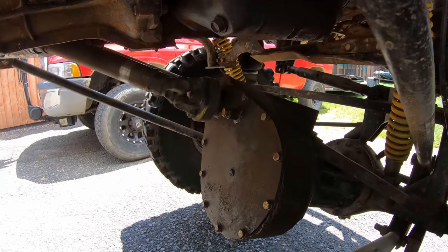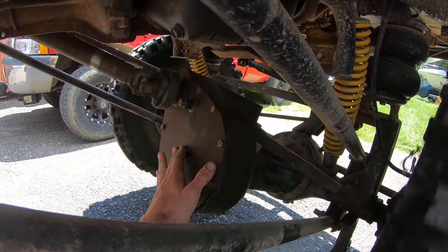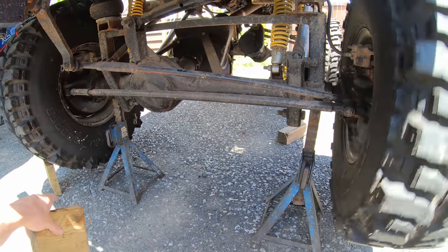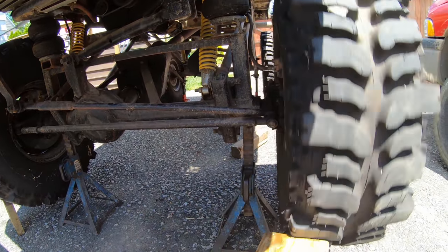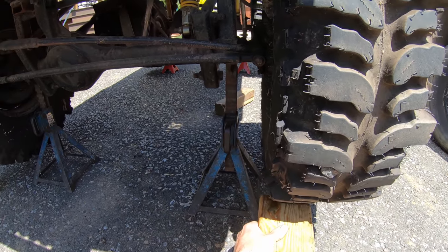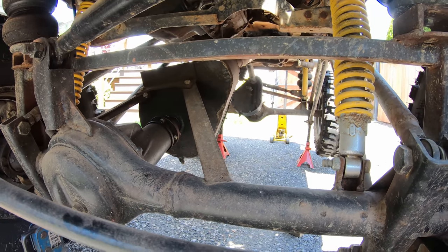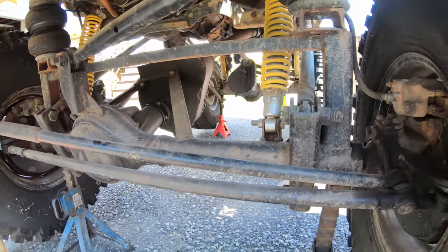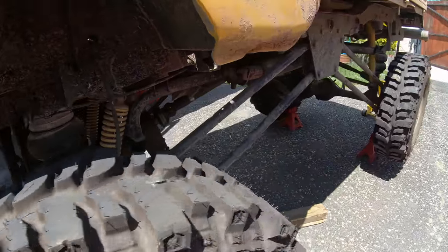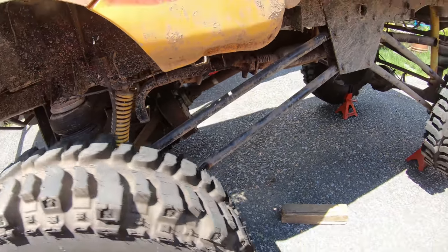And with that in third gear, we got a ton of gearbox noise. Oh man, it just feels terrible, whatever's going on in there. I blocked up that side and this wheel doesn't seem to be spinning that fast. That's not good. Whatever's inside that gearbox is just completely done for, because we've got the hubs locked and you can see the companion flange stopped spinning while the input shaft is still spinning.